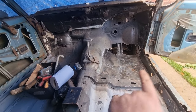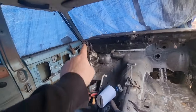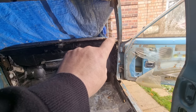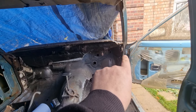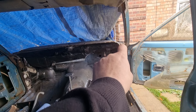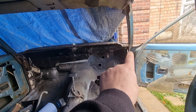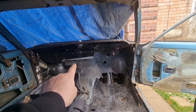After we've done that, we're back outside — the engine bay, A-posts there to get done. I need to build the strengtheners for inside the door posts that go up the pillar. That's the reason I haven't done the scuttle yet, because I need those strengtheners in there. This bottom scuttle section runs up and goes up the pillar here, so I need to get the A-posts done first. I need to get them off and make the things, or source them if I can.